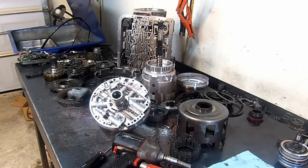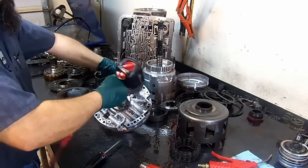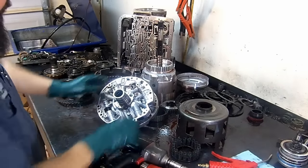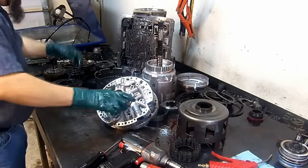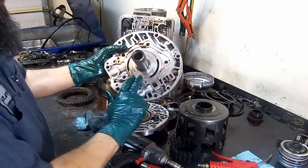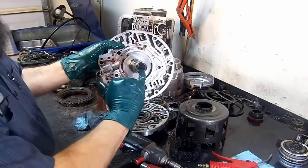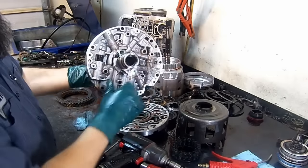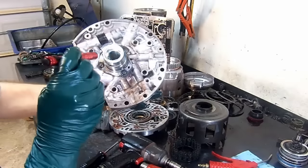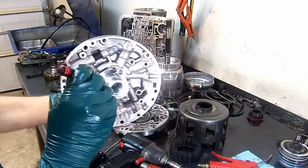Our pump assembly. Always check that the rotor does not score where it rides, on its working area. Remember the babbitt bushings, they gotta go. Install the brass bushings. And inside here, it's in perfect good shape. You will see some scoring marks in it. This is nice and smooth because the bushing is not completely gone.